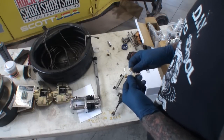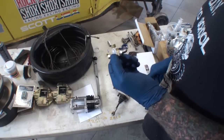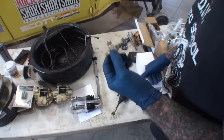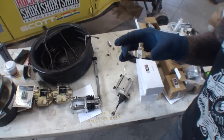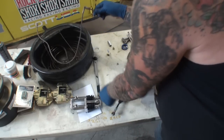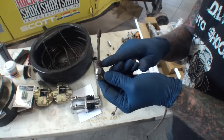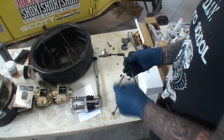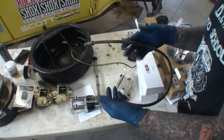Another thing I'm doing is rebuilding all the brake lines. I wish I had another one of these, but to order it would take a week to get here and it costs like $4 plus $6 in shipping. This is our front brake block — the brake fluid would come in here and go this way and that way. The way they had it hooked up before was this mechanism here with our number three fitting, and then a brake line right there. I had to order a braided line for our left brakes because they had this piece of junk hooked up on it.